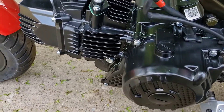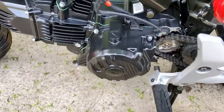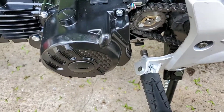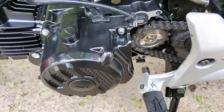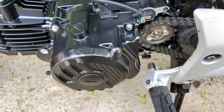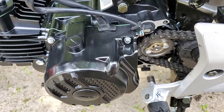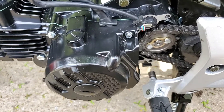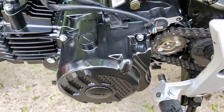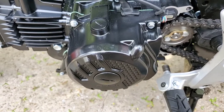I am going to put the oil cooler on — I haven't gotten around to that yet. I've been dealing with the chain issue. I pulled out my caliper and checked the thicknesses — the O-ring 428 chain is a lot thicker than this one. It might end up rubbing on the case back there. I need to determine if it's going to work, because it could wear out that spot in the case, though it won't wear a hole.